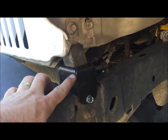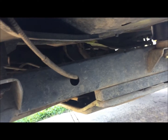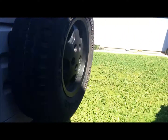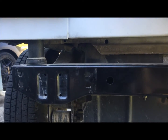I've got the radiator supports and all 11 bolts tightened up. I'm not certain of the exact torque rating, so I torqued them down to where they felt tight enough. One thing that's a little odd — and this applies to any body lift — is you're going to get a small gap, but you can always build your bumper a little taller or put something in there to cover it.